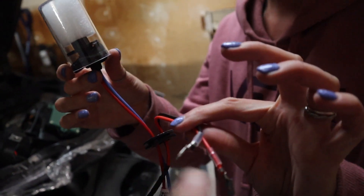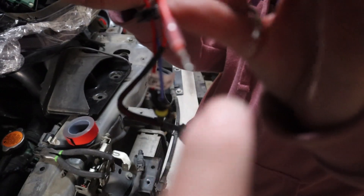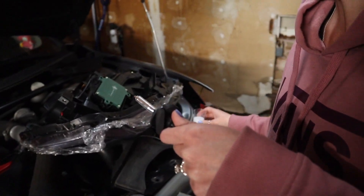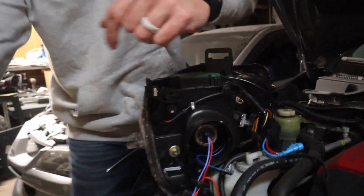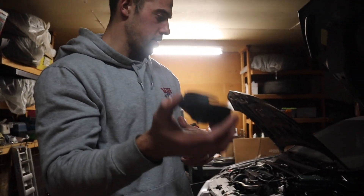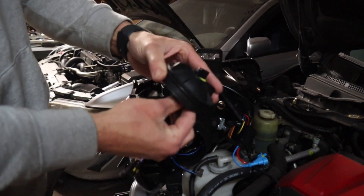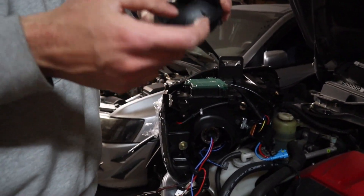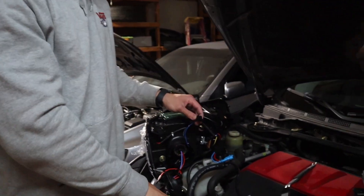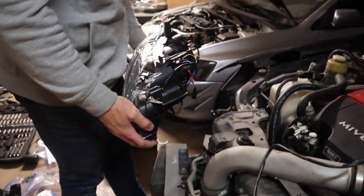This is part of the VLAND kit — two little pins that insert into the headlight. Blue wire acts as red, black to black. Grace carefully removes the outer cap from her HID bulb. The wires need to poke through the outer sealing piece, but there's not enough clearance. I used a metal file and a drill bit to enlarge the opening slightly, which gave just enough clearance to get everything through. Black to black, red to blue — all wired up.